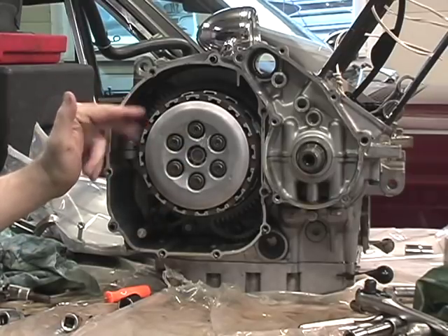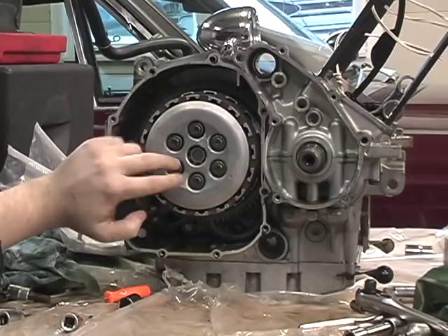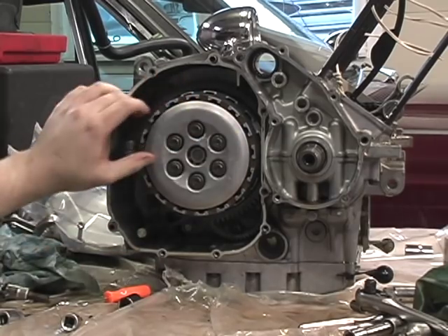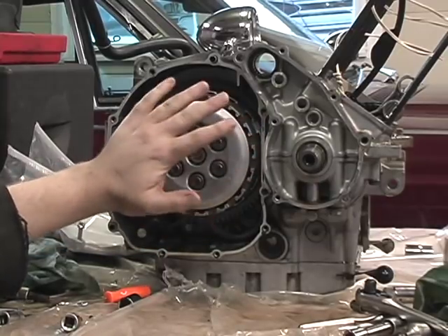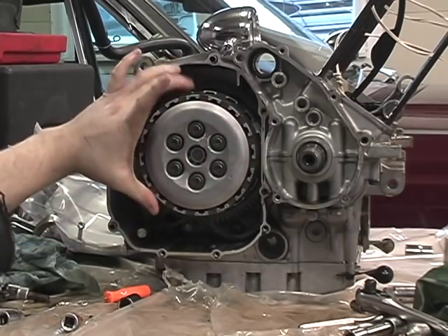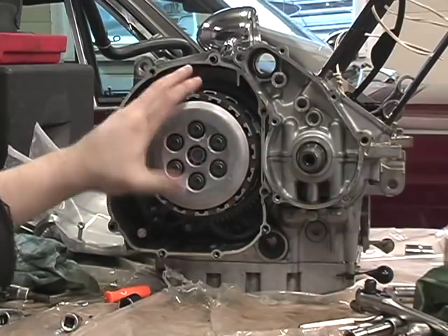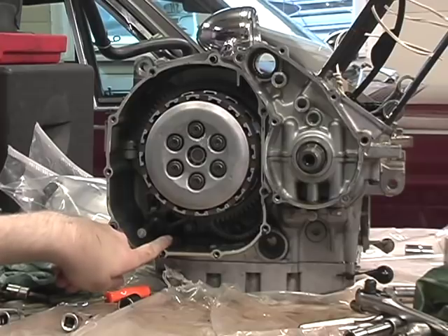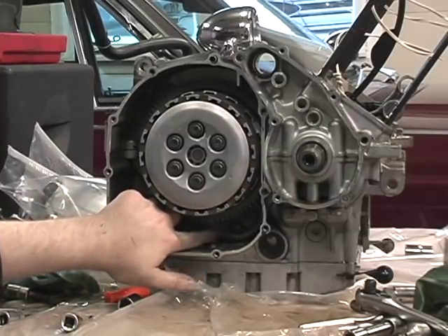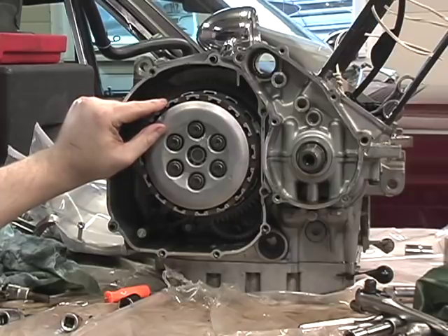Clutch plates — the fibers and the steels are in here. This is the outer clutch basket, and then there is the inner basket which is behind this pressure plate. This can spin within itself. When you pull the clutch lever, the rod pushes against this top hat — there's a bearing — pushes the plate out, takes the tension off and allows it to spin. Let go of the clutch lever, it goes back down; the springs hold the pressure and the plates grab, linking the motor to the transmission. The shift shaft is under here — that's where tabs get bent and the transmission gets jammed up. The detent arm, oil pump gear, drive gear, and star cam. There's really nothing to be scared about doing on the clutch at all.